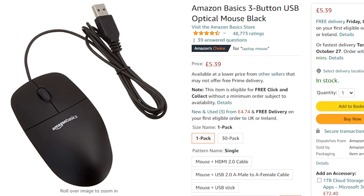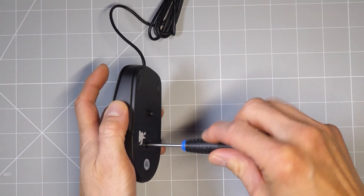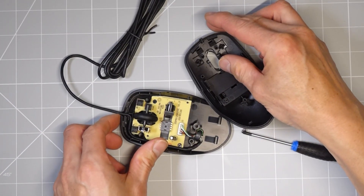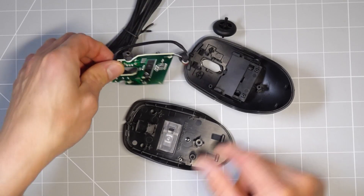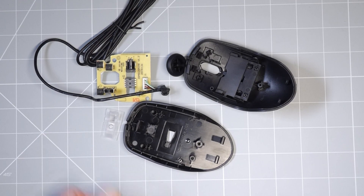And this is the PS2 mouse protocol. For this project I bought a very cheap wired USB mouse from the Amazon basics range. And if you open it up — don't forget there is a retaining screw hidden under the mouse label — you'll find that there's actually very little inside it. There are a few buttons, a scroll wheel with a rotary encoder attached, and the mouse sensor chip with its lens assembly and LED. This sensor chip is then connected to the two data lines in the USB cable along with the power and ground signals.